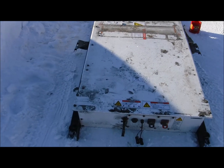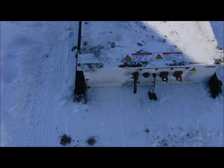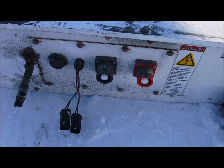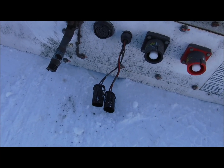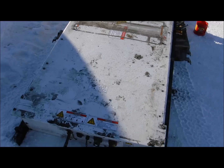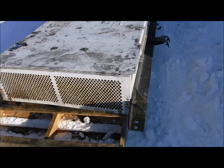Hi folks, I got an electric transit bus battery and I'm going to take it apart and show how it's done. You can see here's the positive and negative outputs, there's a big plug and some other plugs that operate some fans and stuff, and there's a big ground cable. This pack is 640 volts, so it's very dangerous at a very high amperage rate.